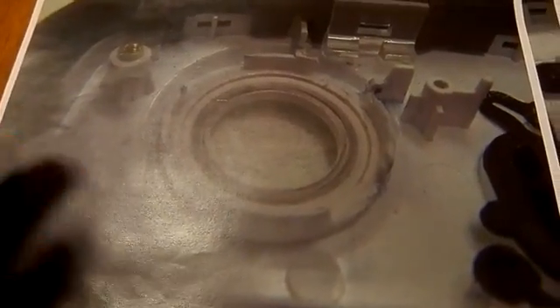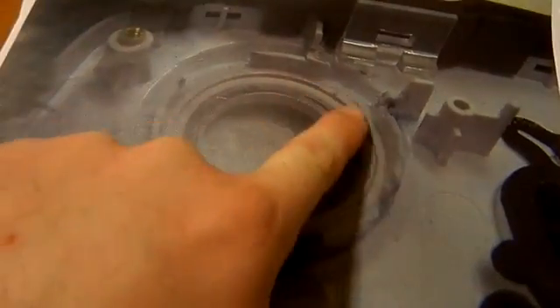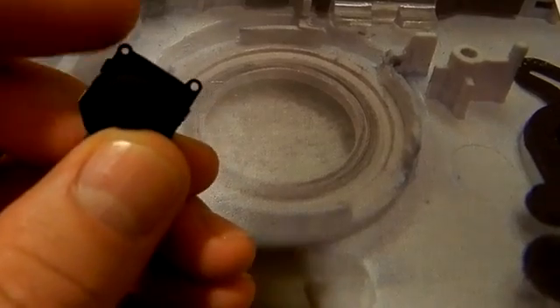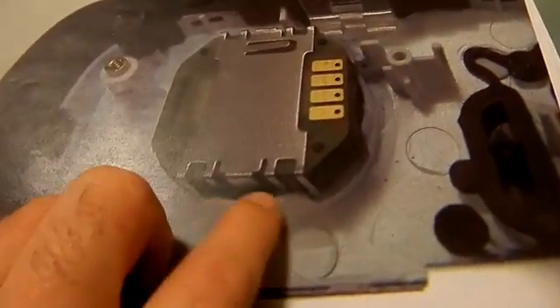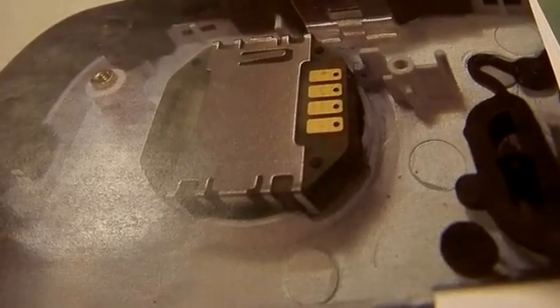Let me show you some pictures of what I've done. Here's the housing — when you disassemble it, that's how it looks. You can see that insert, and I cut it because the switch was so big. Even after you trim it — those bunny ears I cut off and trimmed a little bit all around to make sure it fits. There's not too much room, you have to cut the extra plastic off, which you're not going to use anyway. You can see on that picture the adapter and how the switch fits. If you cut it precisely, pretty close to what I did, you don't have to use any glue or epoxy — the analog switch will stay in.